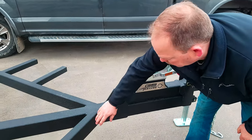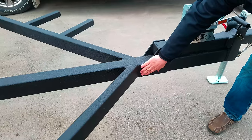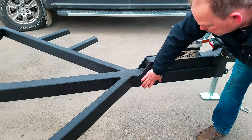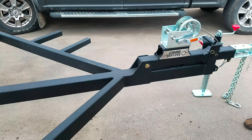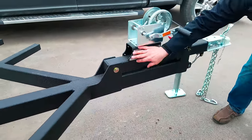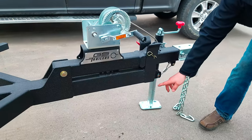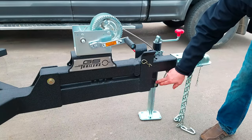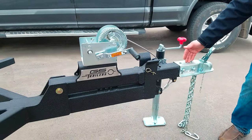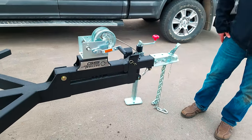One of the biggest things we've done is added a reinforcement plate that goes all the way through part of the frame past the V. This plate is a three-eighths plate that reinforces both sides — there's a lot of force going in here, so we made it very strong. We used grade eight fasteners, capped it off using heavy quarter-wall tube. We've increased the size of the winch mount and ran the front plates all the way down to the bottom, tying into the bottom of the tube. We've increased our tabs so all the force is transferred up into the upper part of the tube, and on the 16 and 17 footers we went with a 6,000 pound hitch. All these combinations make this one of the strongest front trailers out there.